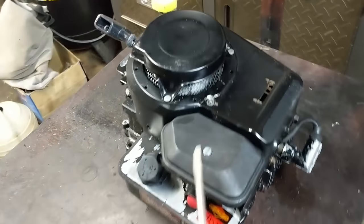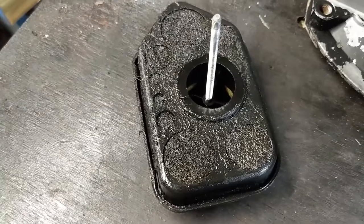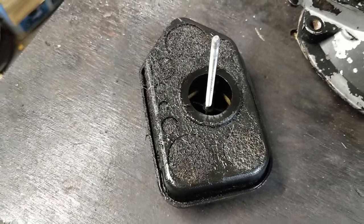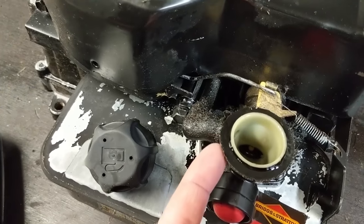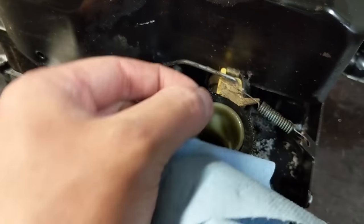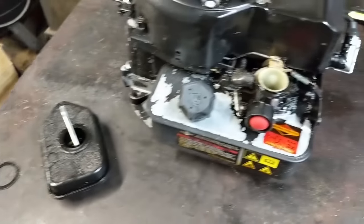The first thing we're going to do is take the slotted screwdriver and go ahead and remove the screw for the air filter cover. Once that's off we can have a little better look at the air filter — just completely gummed up with oil and all sorts of nasty grass and dirt. I'm going to be putting a new air filter on after, but there's going to be a little gasket here and we're just going to peel this off and put that to the side so that we don't lose it.